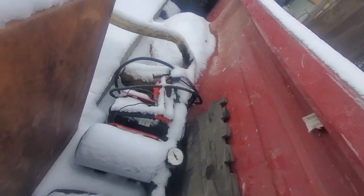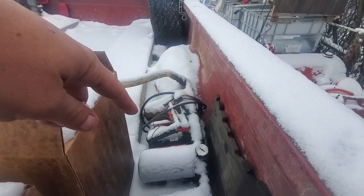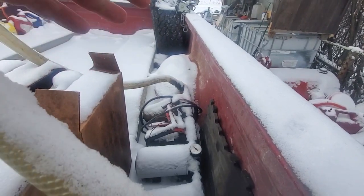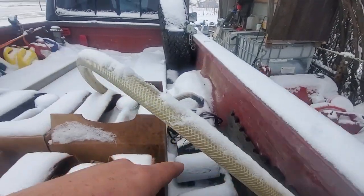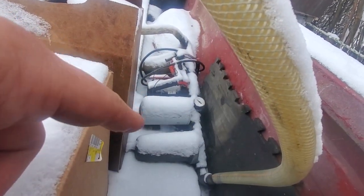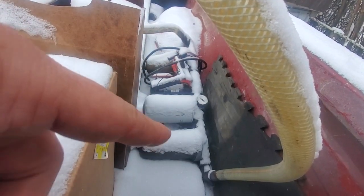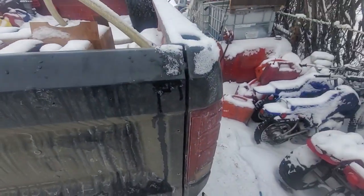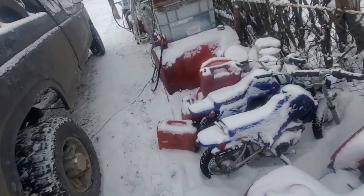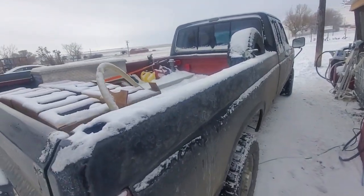There are just two Goldenrod housings. That first one's a Goldenrod housing with an 80-mesh screen in it — I got that flipped because otherwise it would collapse when it's cold. Then just a regular 12-volt transfer pump, you can get them on Amazon pretty cheap or a hardware store. I think I got that from Princess Auto for $100. Then a 30-micron spin-on filter and another Goldenrod housing — they're both water separators. With a 10-micron in it, or whatever you decide to run with.